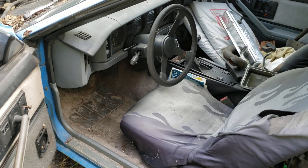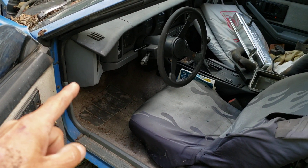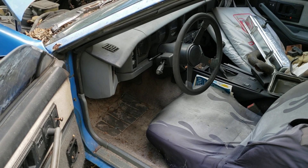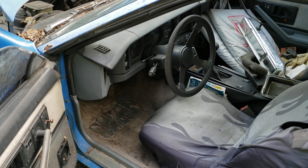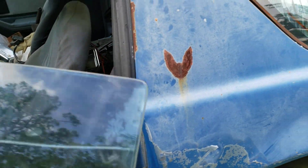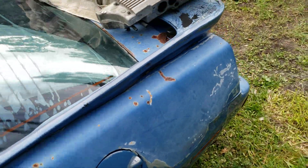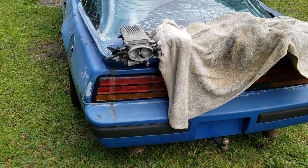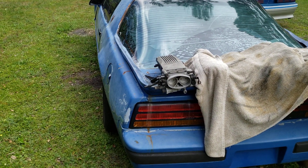I'll switch all the GTA black interior over, get some '90 to '92 Firebird seats — I like those better. The GTA seats put you at an angle; they've got power lumbar and everything, but you're still stuck at that angle. I'll put my '90 to '92 dash in there, switch this harness over to that dash. I have the brackets that hold the '90 to '92 dash that I'll weld into the Formula — I took those out of one of the other parts cars I bought. So that's the heap for 600 bucks.